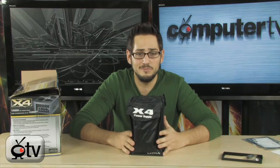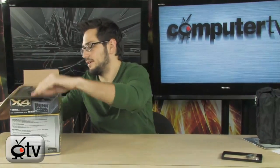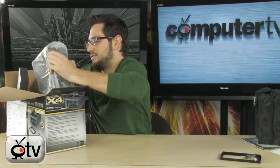It actually gives you the best of both worlds — all the great power of a single rail design that produces over 100 amps of plus 12 volt current, and it is modular too, so you have a clean case design. It's really important to note that this PSU is not standard ATX size — it's actually bigger. So you have to make sure it fits your case. I'll read you the dimensions right now — let me pull this thing out of here.